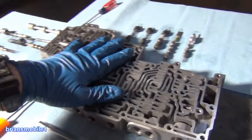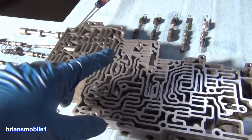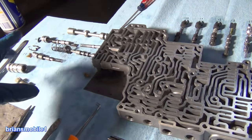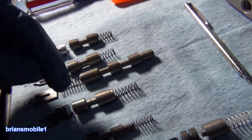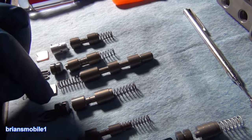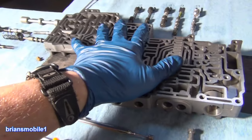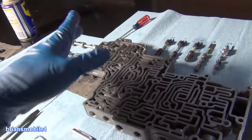This is the valve body, and the valve body has about 19 different spool valves. The key points to understand when you do these: as you tear it down, be careful and lay things out. Each of these has to be able to move — you've got a spool valve with hydraulics pushing one direction from the cap, and then a spring that returns it back. If you can move it easily with a screwdriver or a pick through these little passages, even just a little bit, that's good enough. Do that before you tear it down so you know which holes need attention.